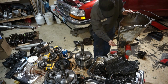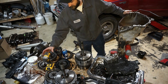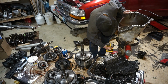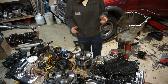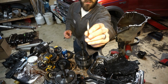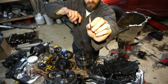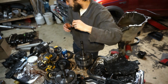So see guys, something didn't feel right, but we made it work. I'm going to do that one by hand. It went in kind of tough, but I want to show you. This was the little ring, part of that 3-piece Torrington bearing. That extra ring was in there. So this was the thickness, the difference that I felt, and why that bolt wouldn't go in there.